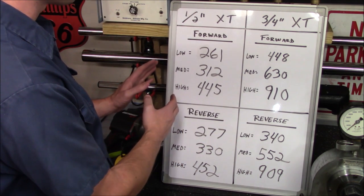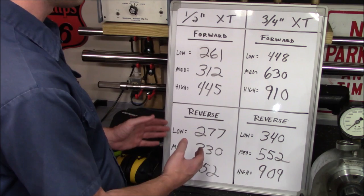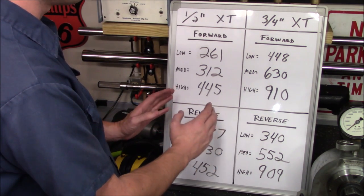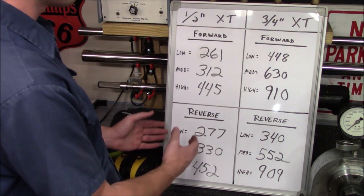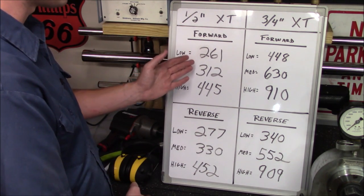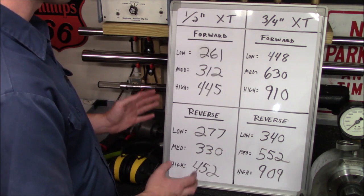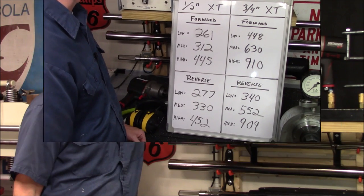But if we use a half inch version, because it doesn't have those extremely high torque settings, even though with something, let's say like a tractor trailer lug nut, it wouldn't be as effective. It most likely could still remove it, but with those smaller fasteners, because it's not applying the extreme torque numbers of the 3/4 inch, you'd be a lot less likely of accidentally damaging something as you're working on it.